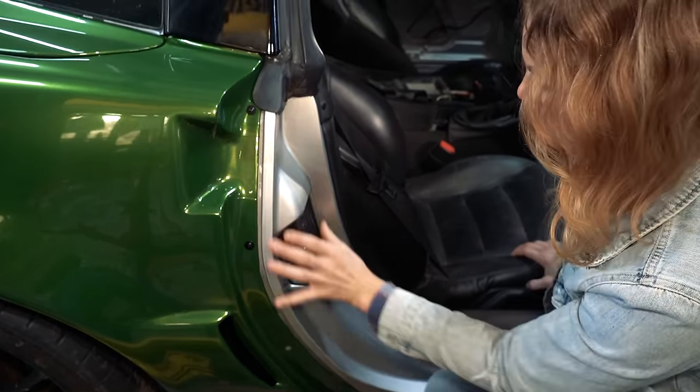Next thing, this is actually the most important thing about the car. Our dimmer switch is bad on this car. So basically you have low lights that go to nothing, or you have bright lights, and you don't get to pick whenever they're on. You turn your blinker on, high beams might come on, hit a bump, they might go off. It's a problem. So I got a new switch, so we'll do that. You have to pull the steering wheel to replace that.